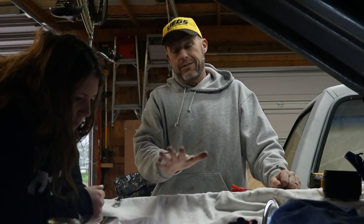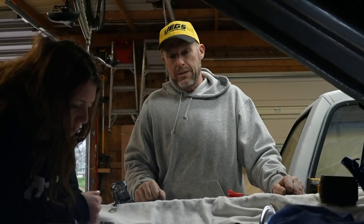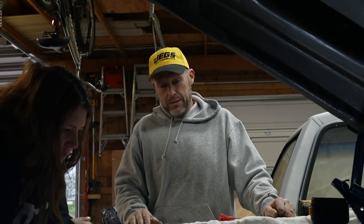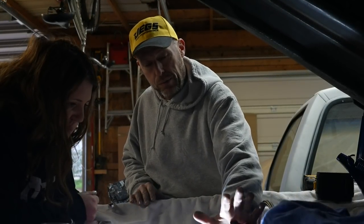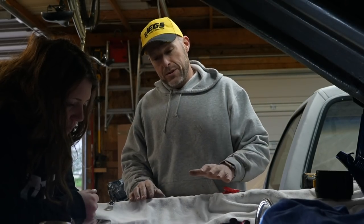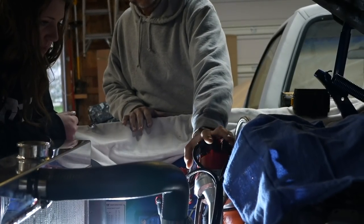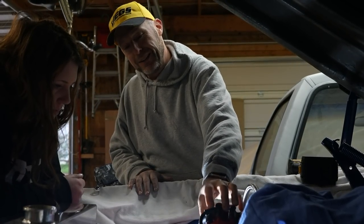These like a lot of advance — way more than most engines — but that's where they run the best. Because I have to pull the distributor out to prime the engine, it has to be retimed again. It's very important that I put things in a certain position before I pull it out, because once it's out I've lost my relationship of what it was. I can only put it back in the way it was if I know where it was.